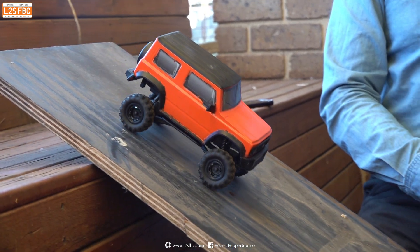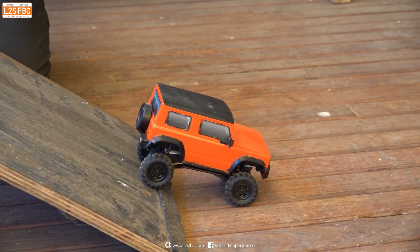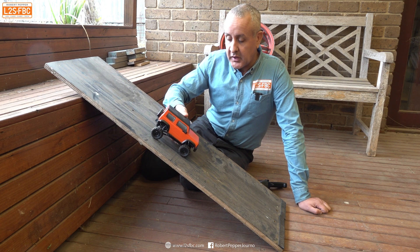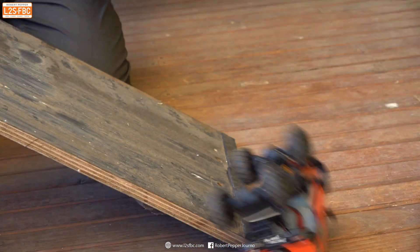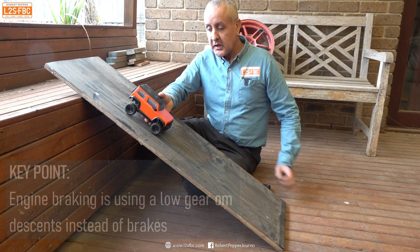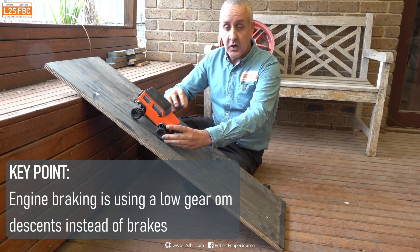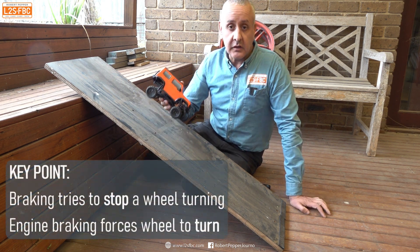Well, it wasn't because the wheels were being braked. That wasn't actually the reason, because if the wheels are being braked they would just lock and then the vehicle would roll — because there's maximum braking being applied, as with the vehicle at the moment as you can see. Once a wheel locks up, then you've got no steering left whatsoever.